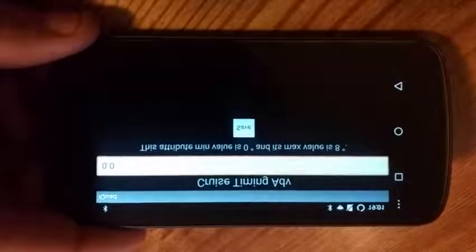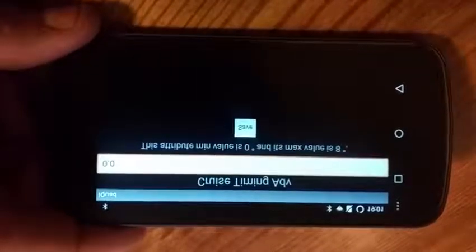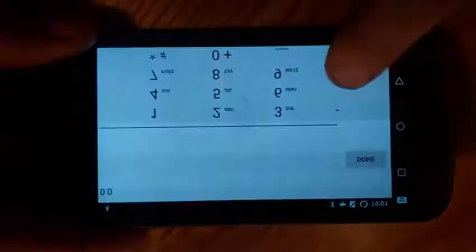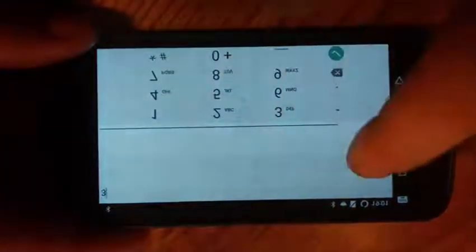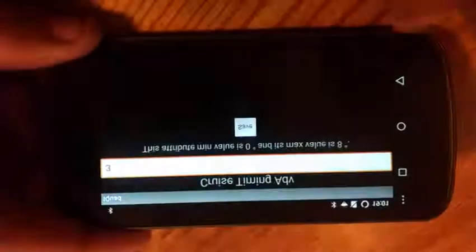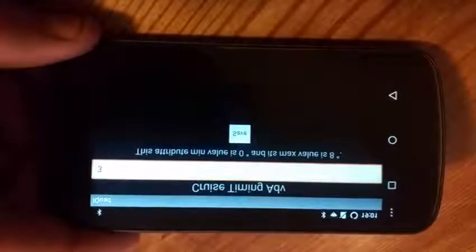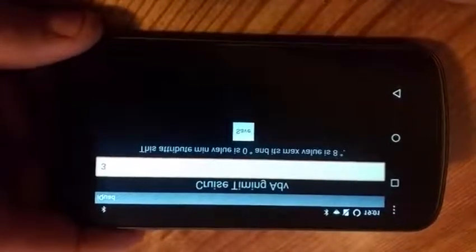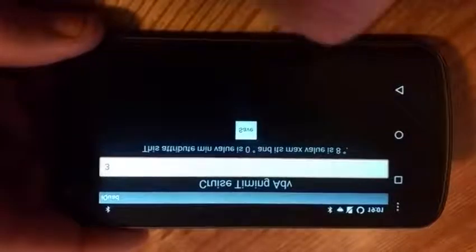So this is a base of 17 degrees. If you want 20 degrees timing at cruise, you'd put 3 degrees here. That's typically what I do. Most trucks will benefit from about 19 to 20 degrees of total timing at cruise. So again, it's 17 degree base timing plus whatever you want here. I'd highly suggest you not go over 3.5 degrees on cruise unless you have head studs or a specially modified truck.